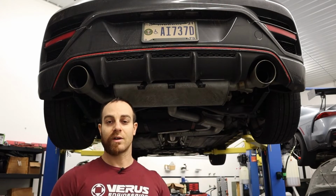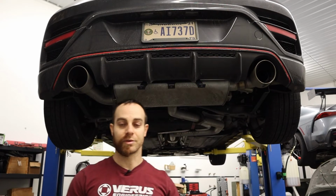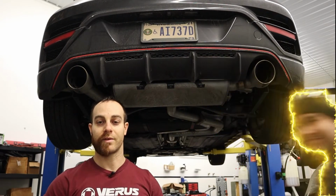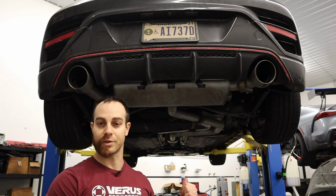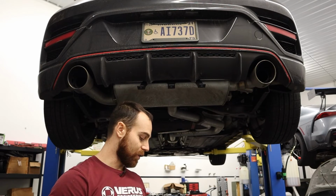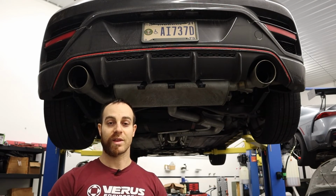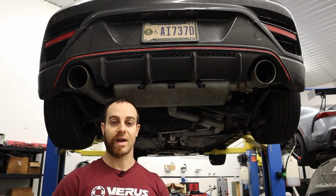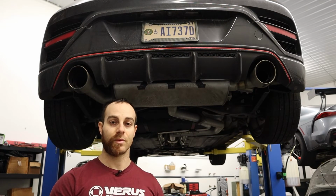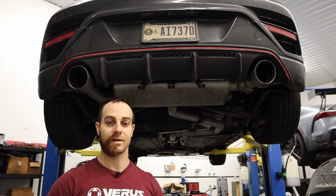We have the brackets installed, so once again, side brackets, rear bracket, those are installed. It helps to have a friend right this moment. There we go. We got a friend over here. Diffuser goes on. We'll basically hold it up, and we're gonna use M6 by 16 millimeter long button head cap screws with a fender washer on the bottom side and then a serrated nut on top. We'll loosely install those. We'll get all of those bolts and nuts installed, and then we'll start tightening them down.